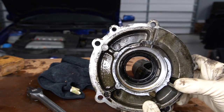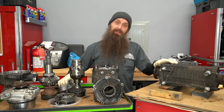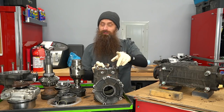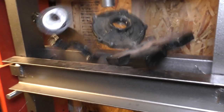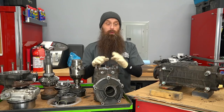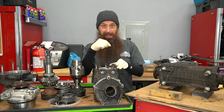In taking down this differential, which is the one that came out of the Black R32, I missed a very key step in the repair manual to remove one snap ring on this plate right here, which resulted in this cover going kaboom. And of course I didn't trust my gut saying this doesn't feel right, Charles, you should stop. I just went ahead pumping. When you keep pumping on that 20-ton press, something's going to give. Thankfully, Brian at One Love had a use diff, so luckily I don't have to try and find a $300-something cover that is no longer available. So we're going to be doing the limited-slip differential install on this diff, but I got this one apart, so let's talk about the disassembly process minus the step I missed.